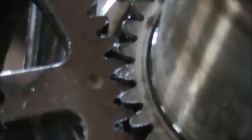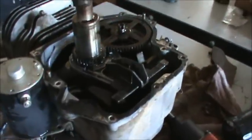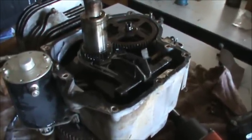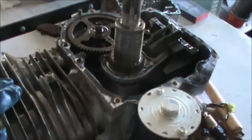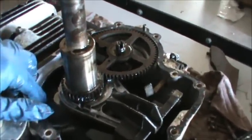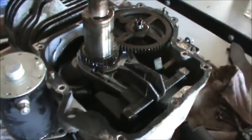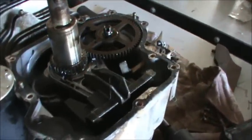Just a little side note — the parts on this engine don't really cost a lot. If you have one with a broken connecting rod and the bore's in good shape, it really doesn't cost that much, especially with used parts. You can get the gasket here for less than 10 bucks. The only other things you'd need besides the connecting rod would be rings, and I would probably buy a new piston if I were going to rebuild it, but you can find good used parts.